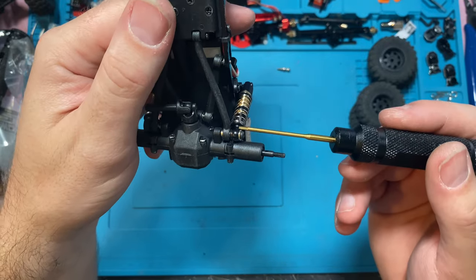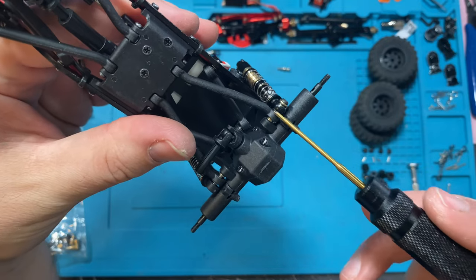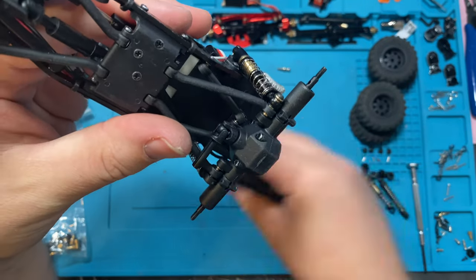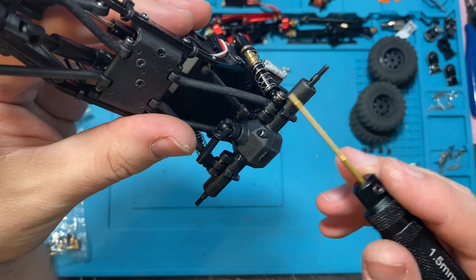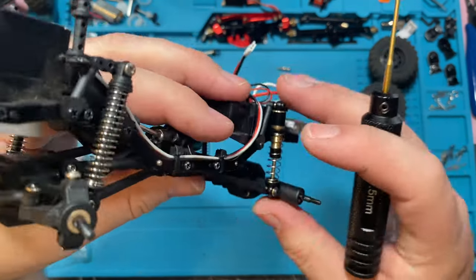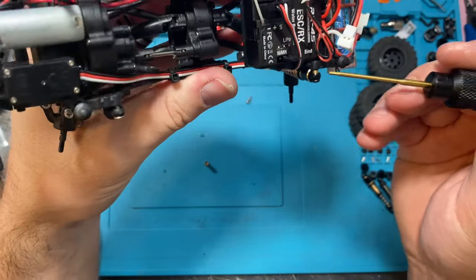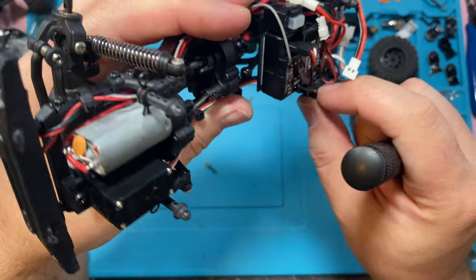It really sucks the shocks are attached to the links on these, and that it's a single piece that connects using the double ball joint, because you can't move your shocks outward at all without moving your links outward. So that kind of sucks. But we work with what we got right now. We can find something to shim in there, I'm sure, but we're just installing it as we got them.